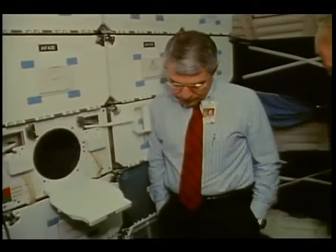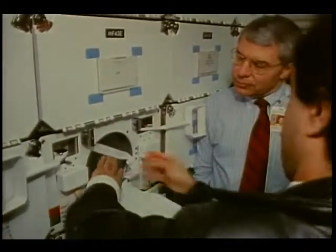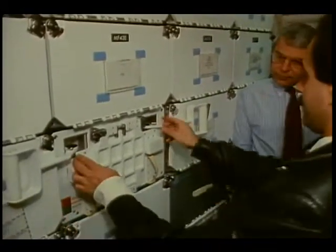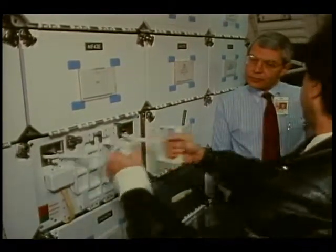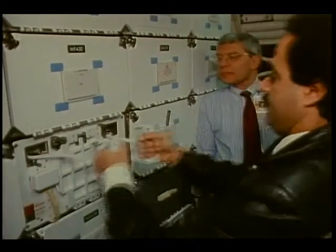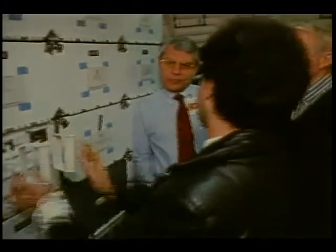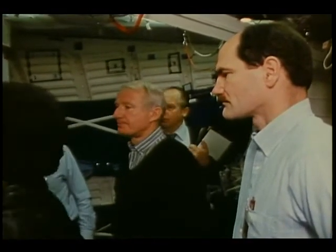Make sure the RAM is fully retracted to the back and insert the trash bag in here. Close the door and the safety. Now we're ready to compact trash — compaction needs to be red, so change the direction of all three levers inward as they are now. It's going to take about 27 or 28 strokes. As you compact the trash, you'll feel resistance, and you'll get a good feel for when you can start.